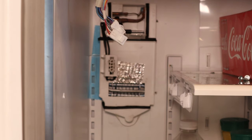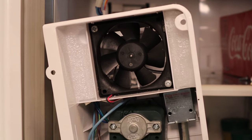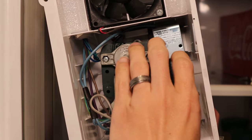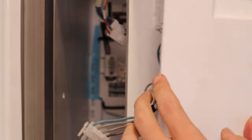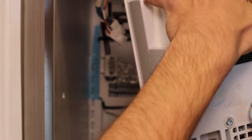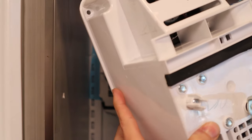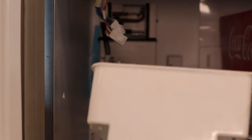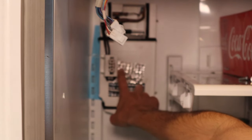The next thing is going to be the actual motor and fan assembly. Next up is the fan and motor assembly. I don't know if you remember when I took it out — there was a large chunk of ice that was kind of just all over this motor, probably something that was trying to keep it from working correctly. Obviously we're going to install it this way because I had the two screws across the top — there's the two screws, and then at the bottom you're going to have this one screw off to the right. The only tricky part is this connector that doesn't have a very long lead has to be connected to that plug.